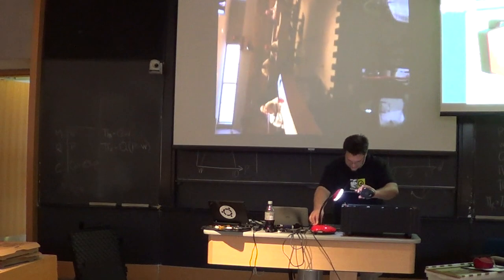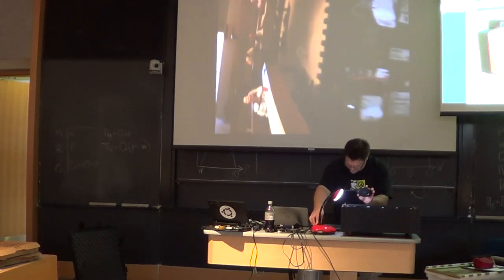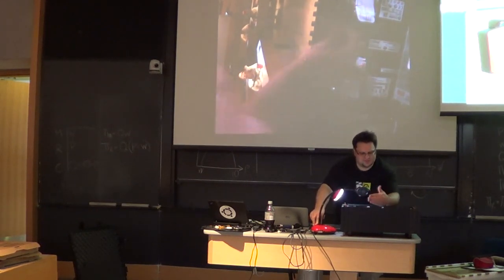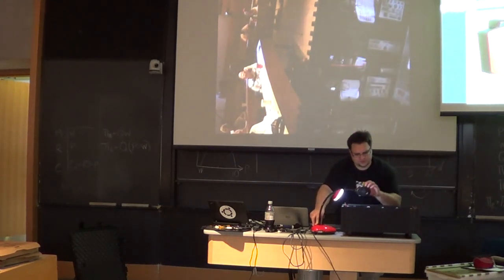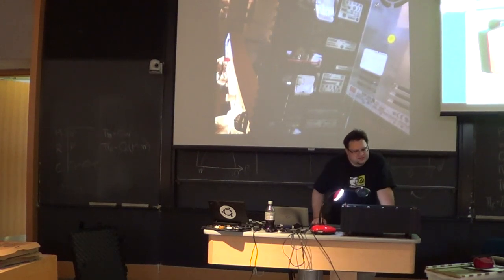The nodes themselves, this is actually a pretty cool shot, too bad you're not recording it, are lining the sides, as I was saying, with the CPU on the outside. They're all Intel NUCs. We chose a certain variant of the board that has AMT on board, so that we can do power on, power off from software. That's what dictated the selection. These have quite a bit of RAM, so they work quite well for us.